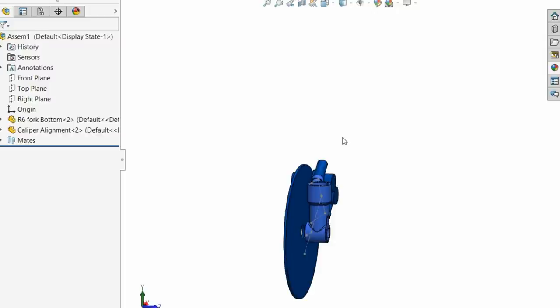And then what I can do is install that into the new yokes. So you know that your new top and bottom yokes will fit the frame, no problem. They'll just slot straight in because they'll have the same steering stem. And actually, the steering stem on the exterior defines everything. It's the nuts and everything. The bottom yoke is your bottom stop, and the top yoke just sits on top. So as long as you get the same thickness of the yoke correct, you're laughing.